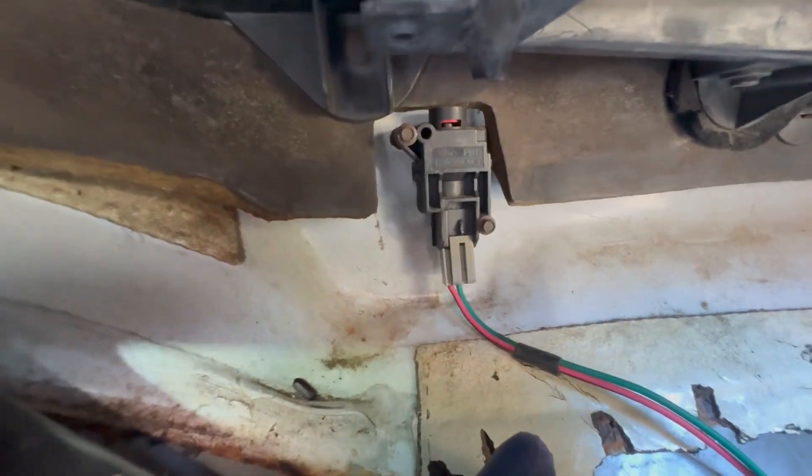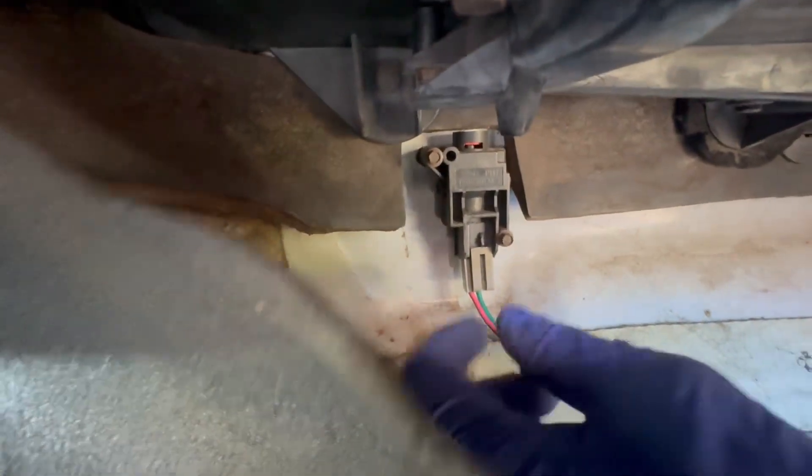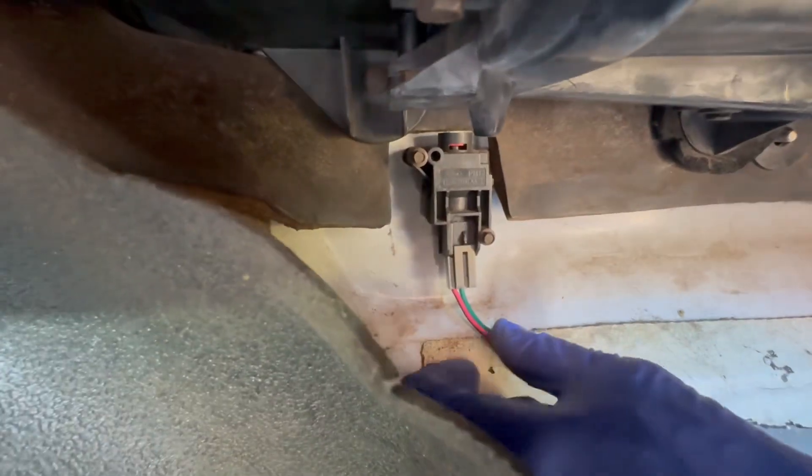If you look, you see that red line up there? That red line is indicating danger — fuel is flowing. So if you don't see the red line, there's a button on the top of this and you need to push it back down to reset it.